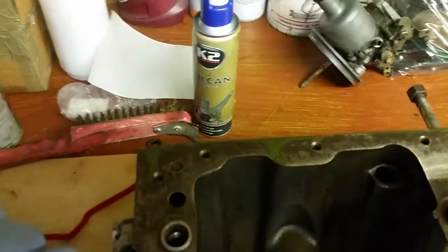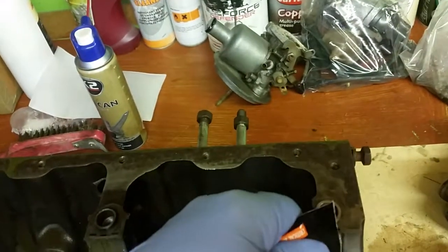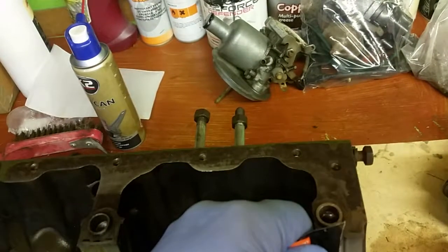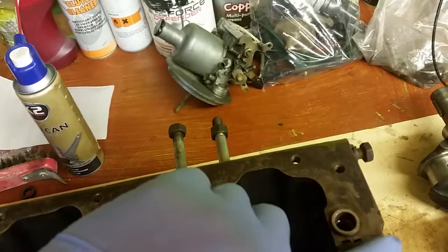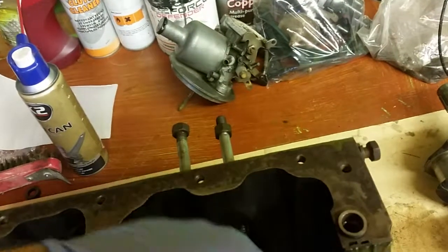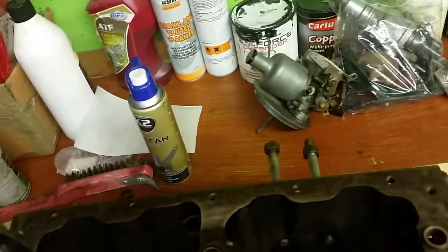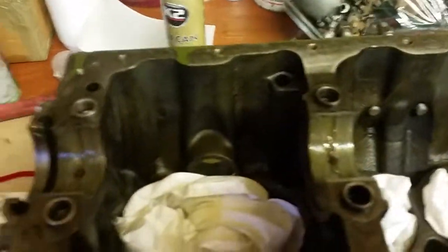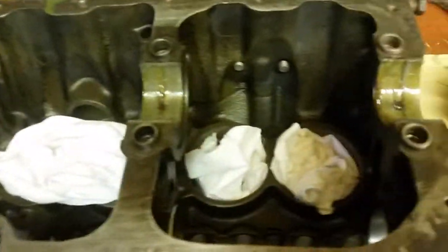It'll just end up costing you a fortune. It'll burn off and it'll just be in the oil that you're going to change after a couple of hundred miles anyway. But these bearings, you need to give them just a good smear like that. You've got to do both sides really. So I just work on like one packet to do me mains and shells and conrods and everything like that. So that's the first part of the job.